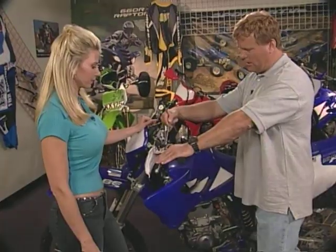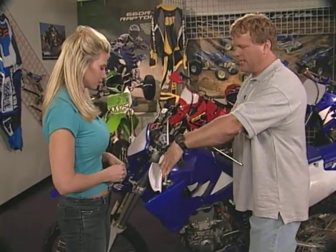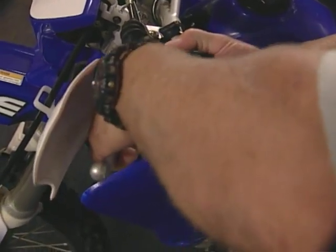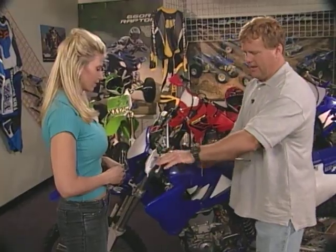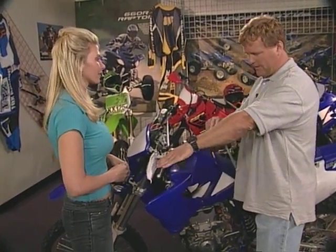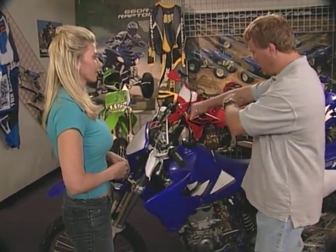I always like to keep my levers where my forearm and my hand are all in one straight line. A lot of people, sometimes you'll see them with their levers down here. But for me, if your hand's rotated up like this and you hit something, your wrist is bent, boom, it's easy to snap it. Also, if you bring it up too high, I've seen some guys where their levers are way up high and their wrists are kind of bent like this. There again, it's my rider preference, I like to keep everything in a nice straight line. So if you hit something in your jar, you're in a nice straight line.